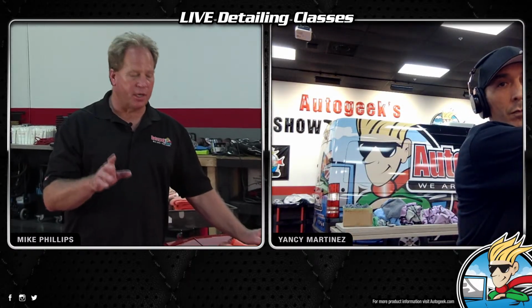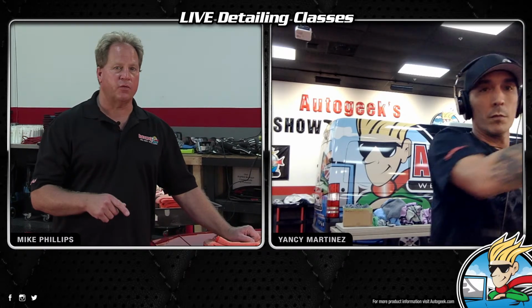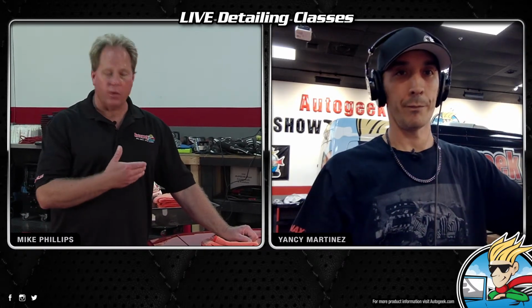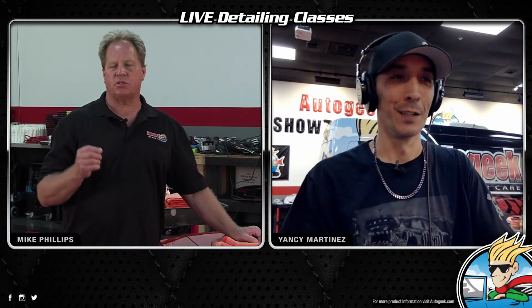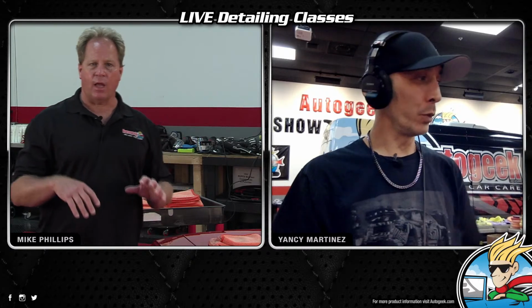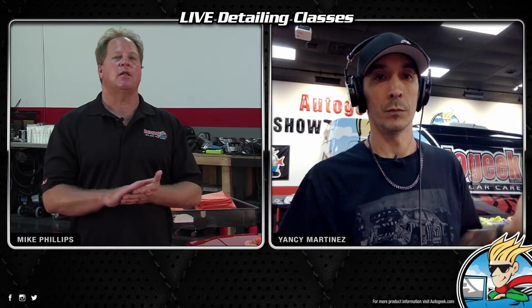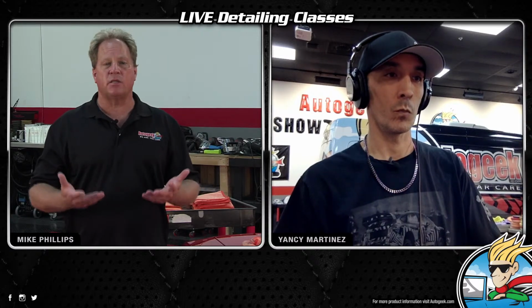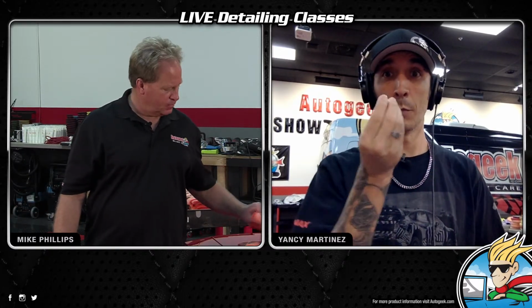I'm telling you straight up, when you're doing work like this, if you try to take it too far, you're going to go through the clear coat, and now you will get rid of the ghosting because you're going to get a paint job. So when you're dealing with customers, just lower their expectations and say, look, Jim, I can't remove this 100%, but I can definitely improve it. Then do your best, and they're going to be happy, and you're not going to have to buy a paint job. Keep that big picture in mind.